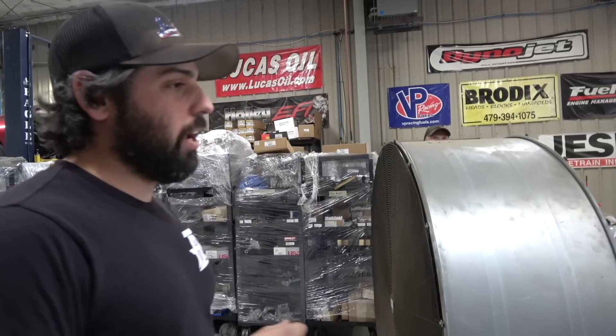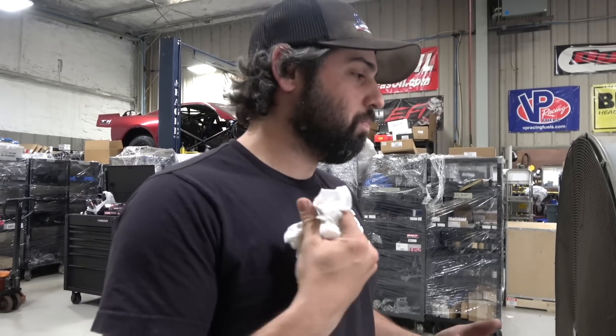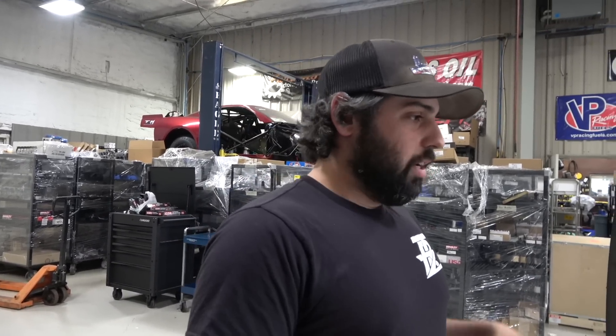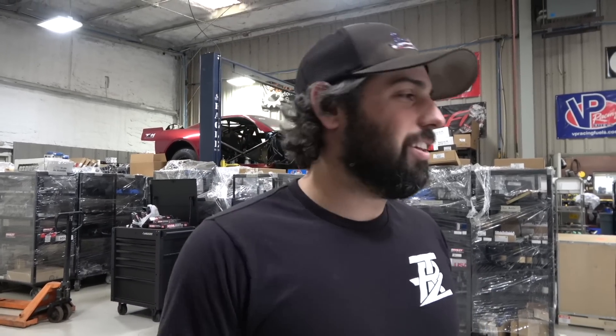Kevin's already been in there tuning on it a little bit. I poked around and changed like two things, but I don't even think my computer was hooked up to the Holley. I even made the title of the last video 'me tuning' as a joke because I didn't really do anything — though I did add some cranking fuel. You hear that thing fire right up? Kevin's strategy: we've already gone through the basics last time — verify timing, go over the tune, make sure everything's good. Being this car has already been here and hasn't been messed with, we're going to start where we left off.